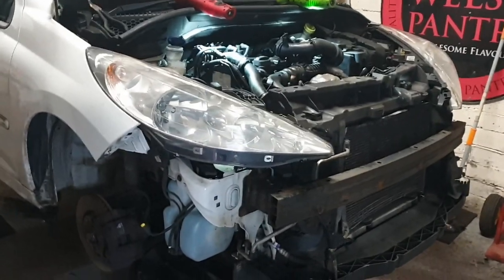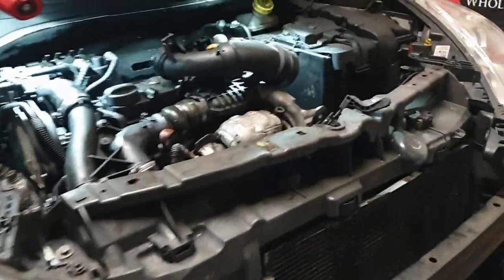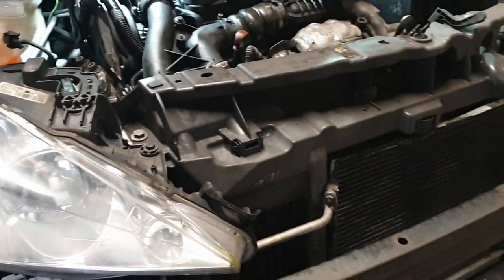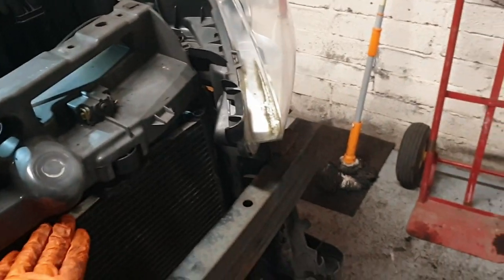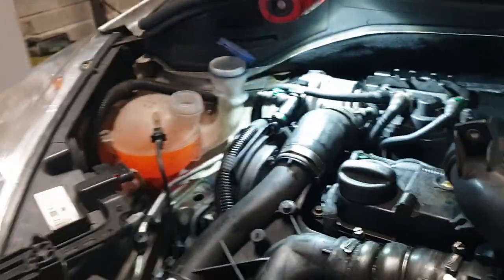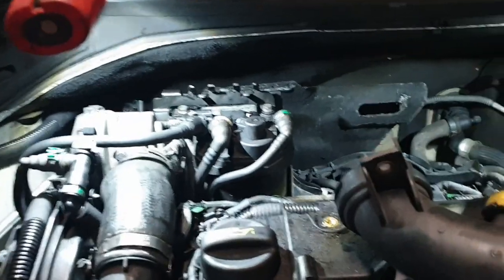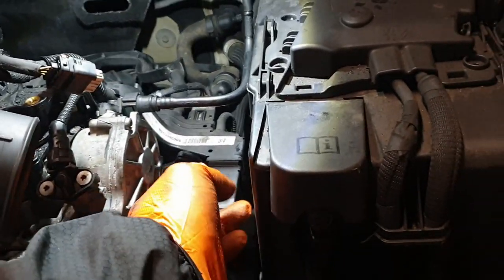Alrighty then. But now we're, according to when I filmed the last video, about an hour further on. It goes back together pretty fast by the time we get to this point. So we've got headlights in, intercoolers in, connected, aircon rad is completely knackered, but it was knackered before. Crash bars in, they're all bolted up. Put 4 litres of antifreeze in it, which could have put some water in, really. Bled it at the bleed screw on the thermostat housing until it comes out of there.